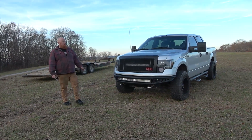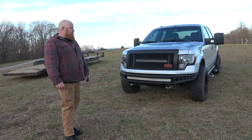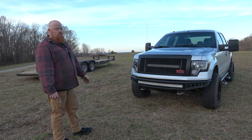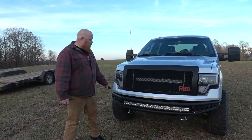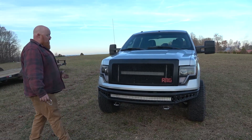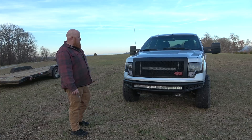So that was the bumper install. There were a few little things we had to modify, but I kind of knew this going into it — I looked up videos on YouTube and there were two very crude videos that showed having to cut those things. Pretty straightforward process; if you have two people it's very handy, but removing everything is no problem with one person. I think it looks awesome. In the future I'm going to cap this off with eighth-inch thick steel, which means we'll have to re-powder coat it, but I'm also going to end up welding the two pieces as one and add a plate that goes flat straight back under it to make it look a lot better. We were able to reuse our tow hooks and tied the light bar into the passenger side fog light by cutting the pigtail off and soldering red to red, black to black.